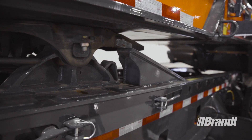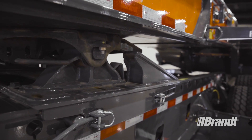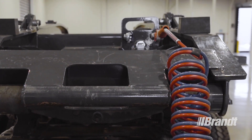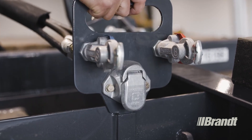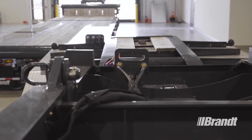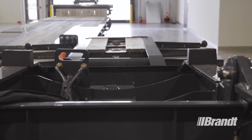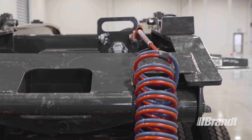The outside flange on the rollers follows the frame rails, making it easy to keep the trailer aligned to the fifth wheel for faster hookup. It also features a movable air and electrical connection point. Simply lift it out of the retainer at the front of the trailer and move it to the front of the gooseneck extension, or vice versa. This will save you time, reduce the number of total connection points, lower the chance of failure, and ultimately make this trailer far more reliable.